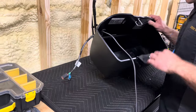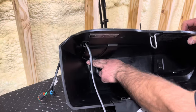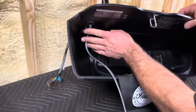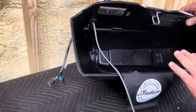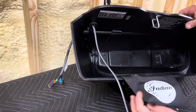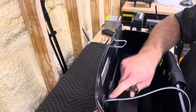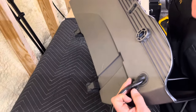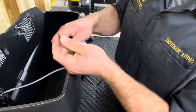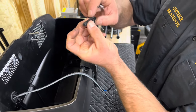Now what we have to do is, you've got this wire track here. These are 2 3-millimeters, 4-millimeter, and this is a 6-millimeter here. We're gonna take this track out, follow the OEM wiring down through here, so that way it looks as OEM as possible, and then we'll route it through here, and then we'll go get the other lid, swap it out, and keep on going. This one right here has 2 3-millimeters that have a plate here with welded nuts. So you can just hold the backside, break this loose. As you can see, you got your 2 small 3 mils with that welded plate here. It's a plate with 2 welded nuts.